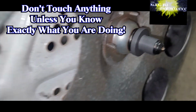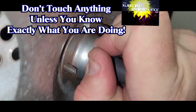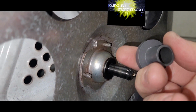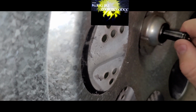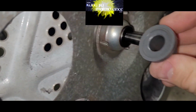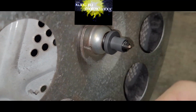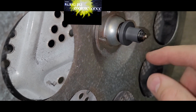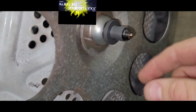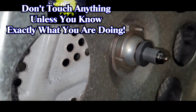All right, for a squeaking dryer, here's what needs to be replaced: this piece, it's deformed, and the little O-ring that's on the front. I'll try to put a link for those in the description below, but it's just a matter of changing those out, and you don't really want to use any kind of lubricant. It's better for it to be dry. This one's a little deformed, so you might need to order a new one. That's the story there on this dryer.